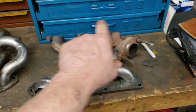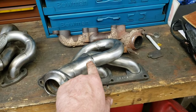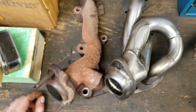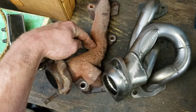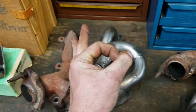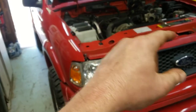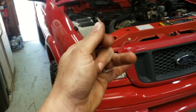That's the best way I know how to explain it. Efficiency - little squeakers, shutting the door, feels so much better. This little engine is going to be able to breathe, and by breathe I mean exhale. So there's that side-by-side comparison. Here's the passenger side and here's the driver side. You notice one tube is the size of the whole log - it's just going to breathe so much better. When you get more out, you can get more in, which means more horsepower, which means better efficiency and better power-to-weight ratio. If you got something that weighs a certain amount and you add power, you essentially add efficiency because now the engine doesn't have to work as hard to move the vehicle. Does that make sense?